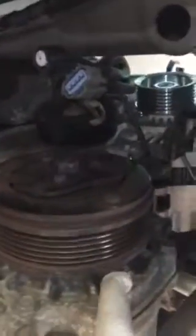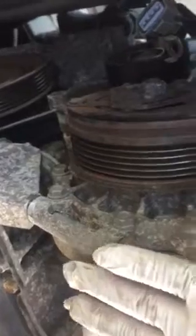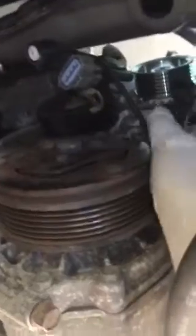And to take out the alternator, you need to remove the AC unit out. Don't take out everything, so take out all the bolts. This bolt right here, a few bolts on the back there, 2 more bolts, and then have somebody help you hold this AC right here, and you can take the alternator out this way, from right here.